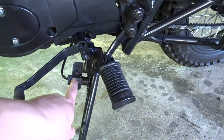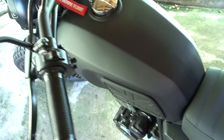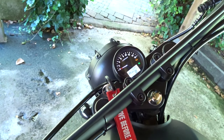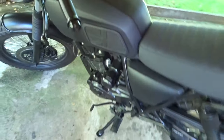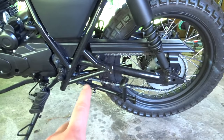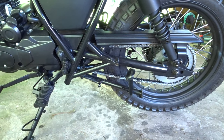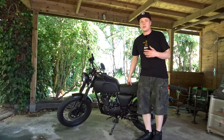The modification I'm talking about is this switch right here on the kickstand — that prevents you from starting the bike. I'll show you what happens: I turn on the ignition and try to start the bike. It will crank over but it will not start unless you remove the kickstand and put it in the upright position.